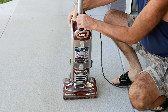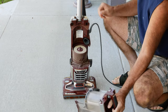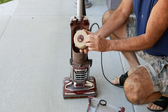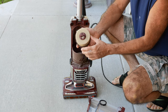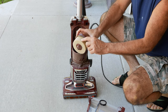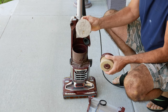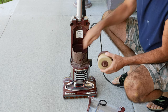There are some filters here, so just take the canister off. There are two filters. There's one here — this one can be washed with a water hose. If you do wash it, I recommend letting it dry completely so that you don't wind up pulling moisture into the motor. Or you can take compressed air and blow it out real good, just be careful not to damage the filter. There's another filter here, and I believe this one can also be washed or blown out with compressed air.